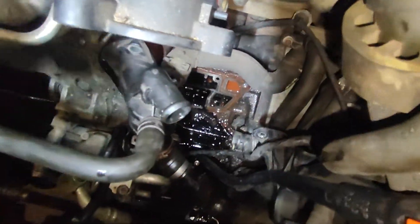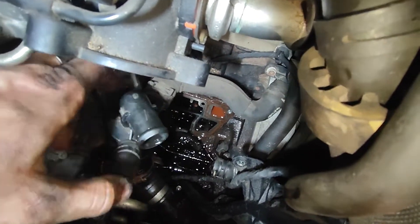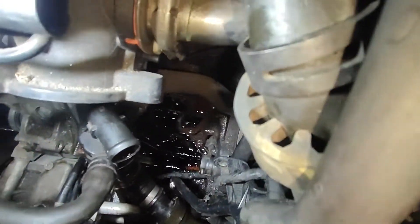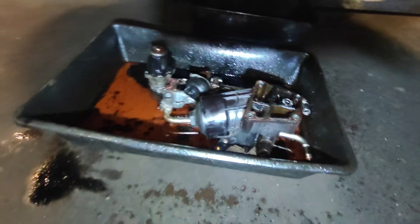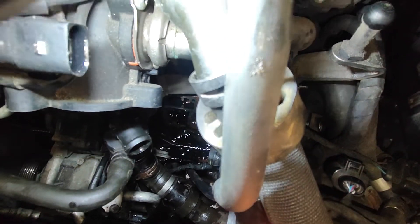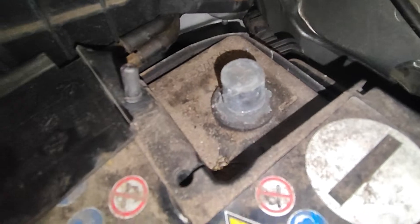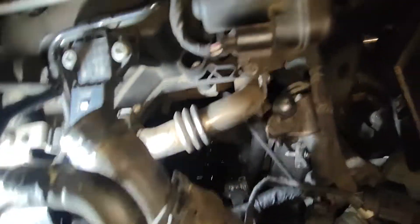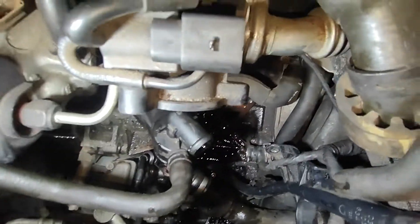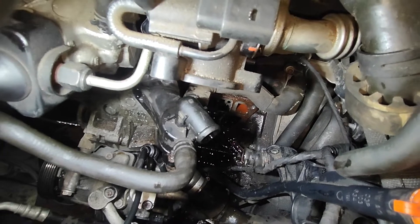It's very hard to reach the clamp. While you're at it, get a new seal rubber ring for this one before you put it back. Don't forget to put some buckets under the car because otherwise you're going to have a very big mess on the floor. Also, when you take out the alternator, please disconnect your battery — I always just disconnect the negative.